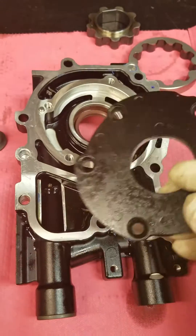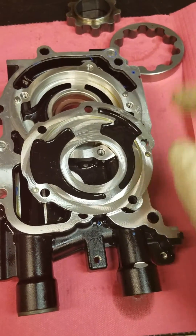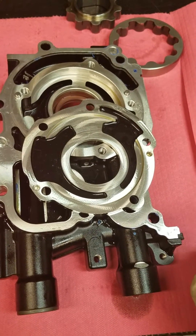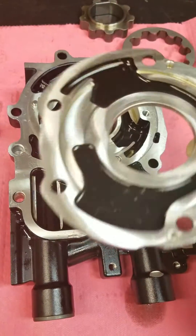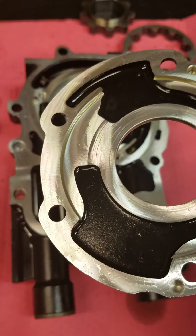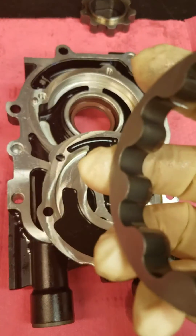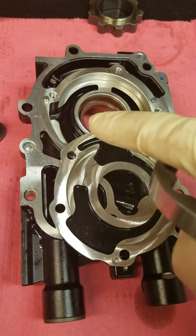The other real negative to this pump is it uses an aluminum backing plate, which is not very stable. These rotors, especially the larger ones in diameter, can chatter around when you hit the rev limiter or two-step, causing wear on the plate as you can see here. The aluminum surface is also easier to gouge — there's a fairly significant gouge in there, which is just from the two edges of the pump gear riding for a long time. I do typically deburr the edges of the pump gear when I install one, because any sharp edges will cause wear on the backing plate and bore very quickly.